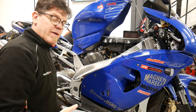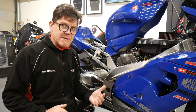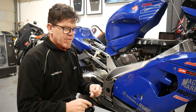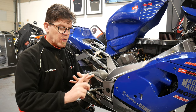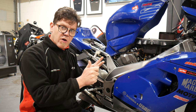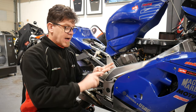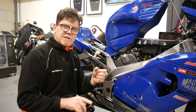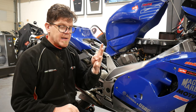So we know exactly what was going on — we just had a problem with the block connector. To recap: your bike's been sat over Christmas or for a little while for whatever reason, it's not working when you come back to it, just cranking and not catching. There are four things to look for. One: has it got a spark? Two: is it fuel injecting? Three: is the fuel pump working when you turn the ignition on? The fuel pump primes the system to put pressure in the fuel injection system for three to five seconds dependent on the map that's installed. And four: does it work when you actually stab the start switch — in other words, does it work when the engine's turning over? If you have all four of those, that engine in theory should run, and if not, you know exactly where to start looking.